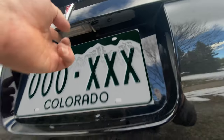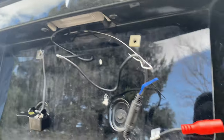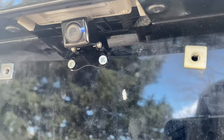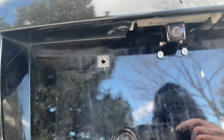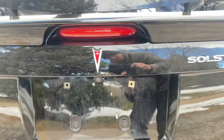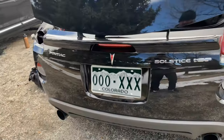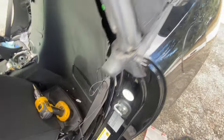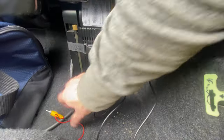There's plenty of space between the license plate light and the rear bumper cover, so I'll just fish the camera wires through into the inside of the trunk lid. I used a couple of aluminum screws for serviceability and adjustment purposes, but they'll be completely covered by the license plate once it's reinstalled. With the plate installed, you can barely even see that the camera is there. Since the armrest is disassembled, it'll make routing the wires much easier — I just have to get the wire from the trunk space routed through and back into the interior.